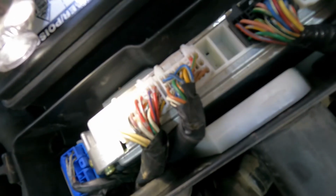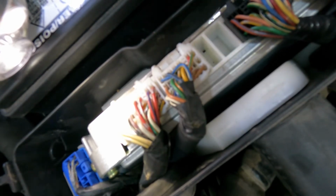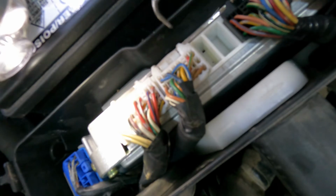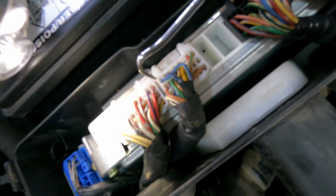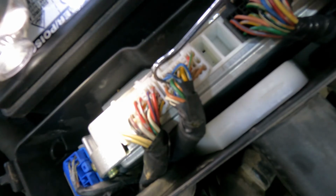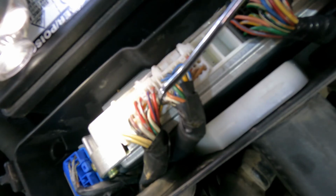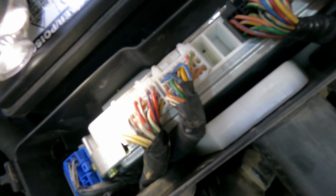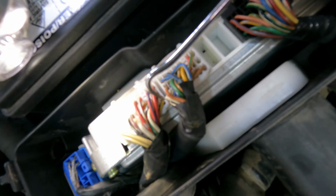All right, everybody, I want to show you the wires involved in your cam circuit. So we know there's a blue and a black and white wire that come directly off the connector. So we come over here and we're searching through all our blue wires, solid blue, to find it. Well, I can tell you that it's second row, second one in. This blue wire is to your cam sensor. Well, you try to check this white and black one right here below it, and you get no signal. Well, that's because it's not it. It is directly related to this cream one.